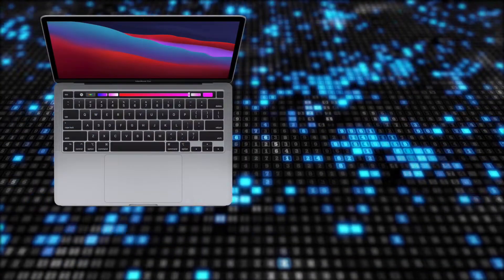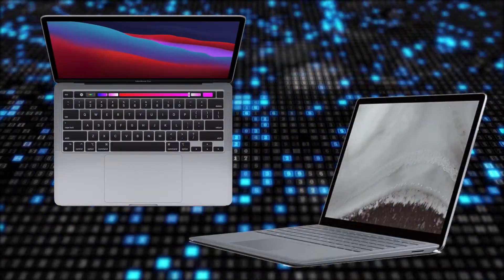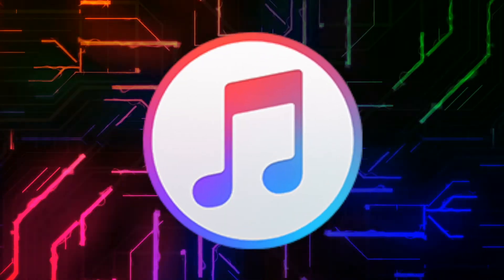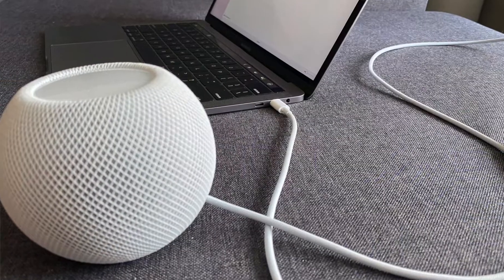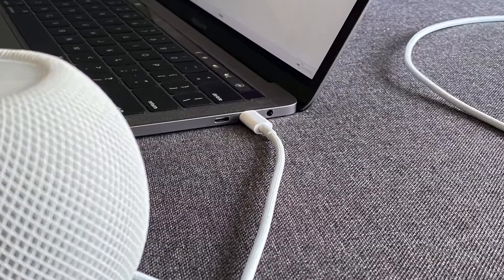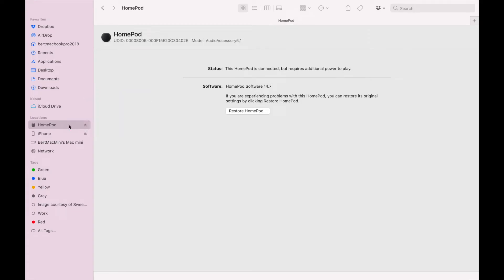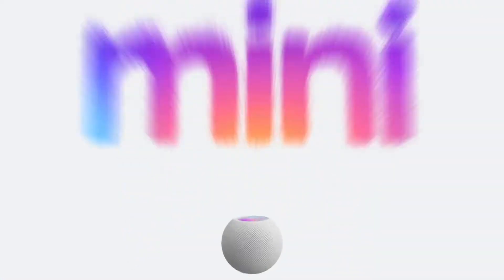And as a bonus, if you have a HomePod mini you can also reset it using a computer — it works using a Mac or Windows PC. For Windows, you would need to have the newest version of iTunes. I'll demonstrate on a Mac though. Just plug the HomePod mini into a USB-C port and open Finder, or on a Windows PC it'd be iTunes. Then choose the HomePod on the left, and click the Restore HomePod button on the right. Remember, this method using the computer only works for HomePod mini since it has a USB-C connection.